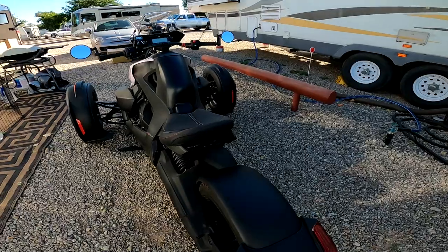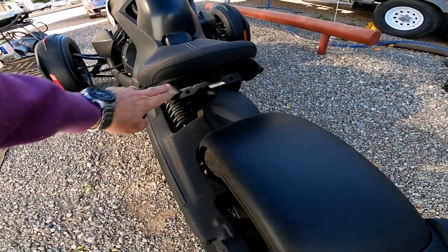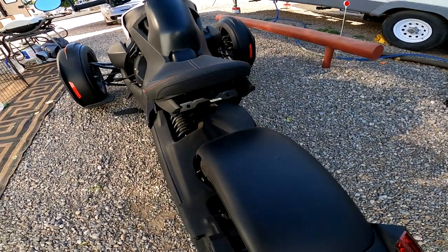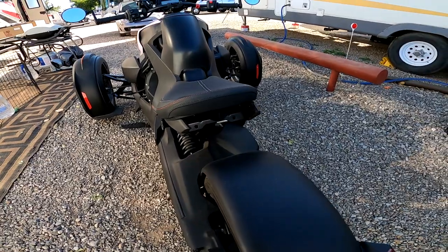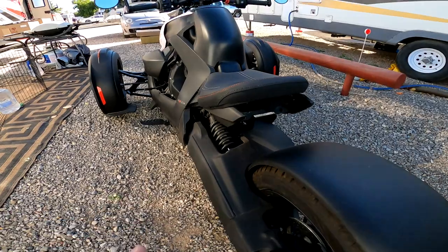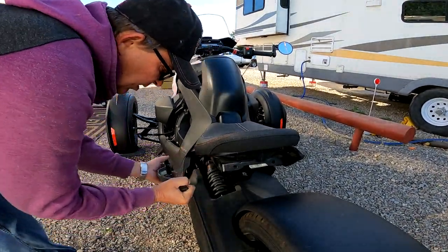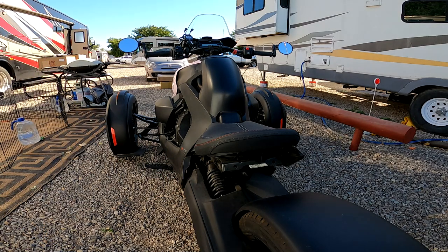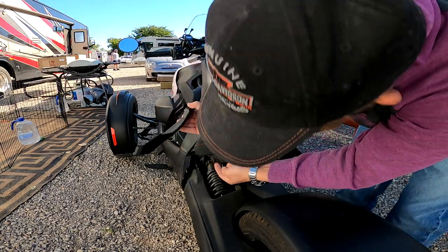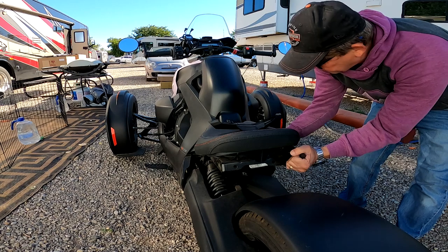Right here is where we need to install the max mount bracket. So we need these fairings off. There has been one here, but we already lost it while driving out at White Sands. The roads were so bumpy, so it simply came off. But I think these here, you can simply just grab them and pull them off. They should be easy to remove. They just sit with small clips and some screws sitting under the seat, like these here. So they're very easy to take off.